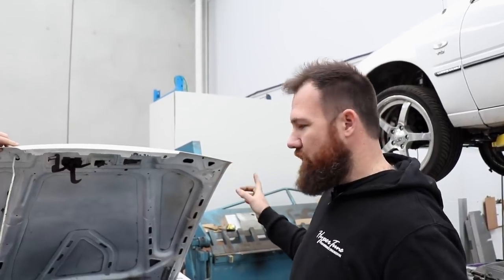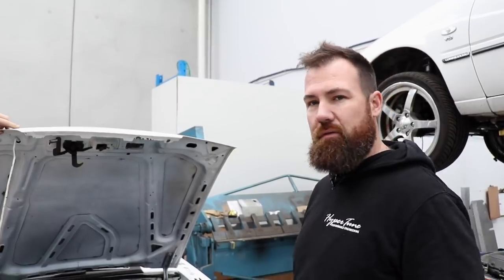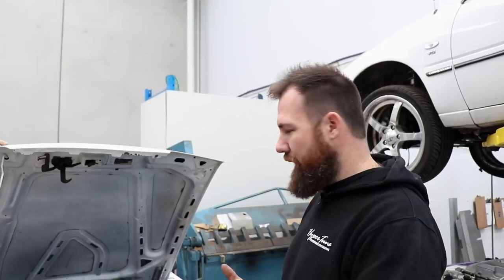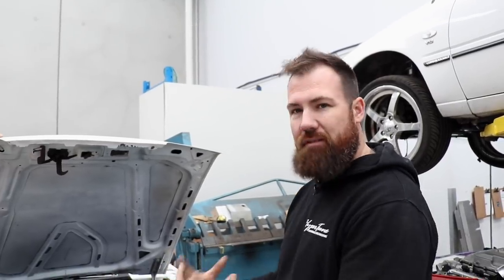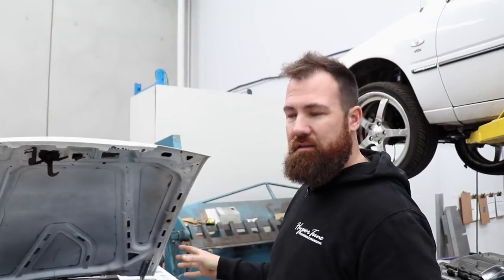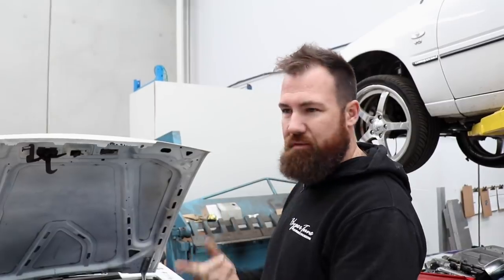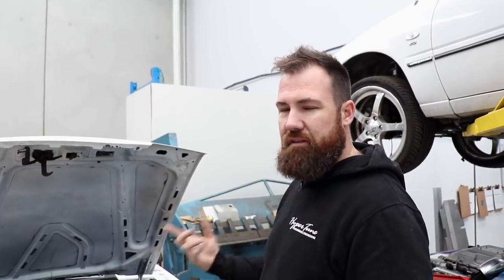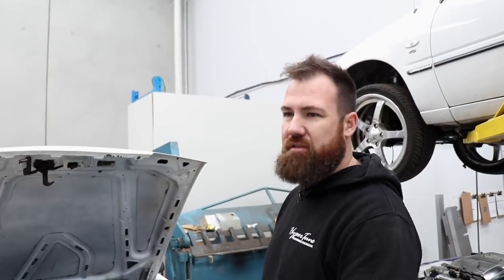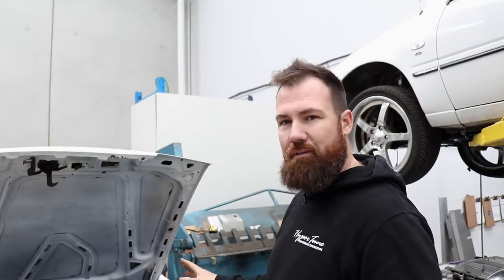The Fox body we've got in the States already has a fuel cell in it, but we are actually going to fit the exact same fuel cell as what's in the Cresta, so we can still do our staged fuel pumps, and that's all inside the tank, because at the moment our Fox body's got a carbureted engine in it, so there's no provision for an in-tank fuel pump. The fuel lines are probably too small because it's an aspirated small block car, so we're going to run dash 10 supply, dash 8 return the same as the Cresta and just keep it exactly the same for consistency.